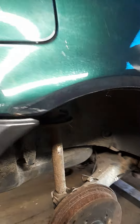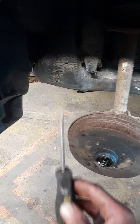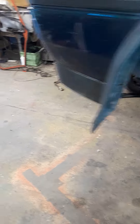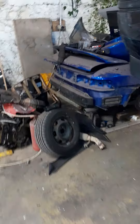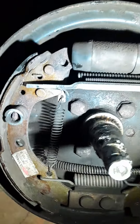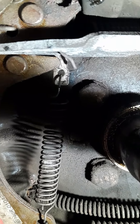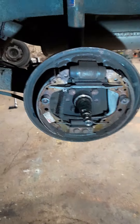Bear with me again as we walk around here. You need a flat screwdriver and a torch. This little chap here — this is going to be impossible to show you in one hand. See where the spring catches in? You're shoving him up, and by shoving him up that releases the shoes and lets you get the brake drum off.